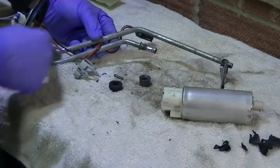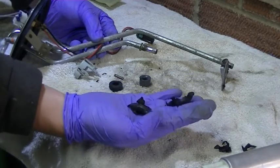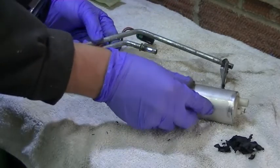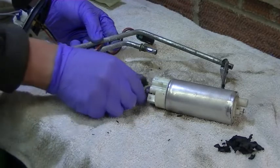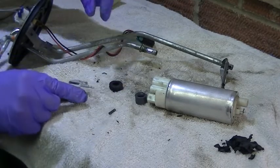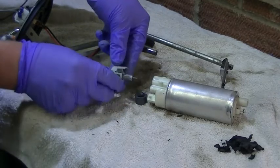Okay, so we have the pipes. This bracket at the end, which had what's left of the rubber gasket on the end to buffer, so the pump went in that way. So pump that way, we then had that rubber seal in the end of the pump, that spring there went on that bit there, and then that went into the pump that way.